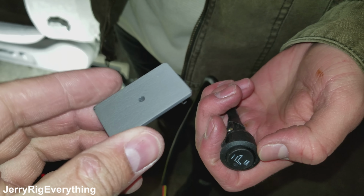And this hole with the half inch wood bit that we used isn't going to be quite big enough, so we're just going to use a razor blade. We're going to widen that hole just big enough so that this connector can get through and the switch can get through, just up to that point. Now we have the hole big enough, we're going to go ahead and slide the plug through and clip the button into place.